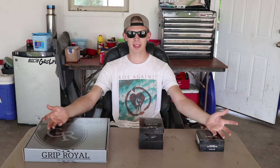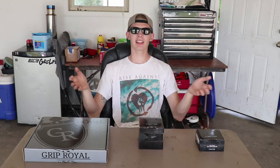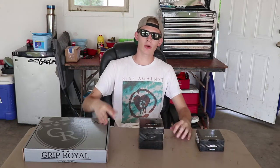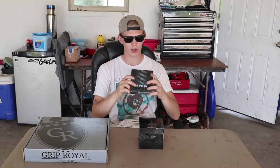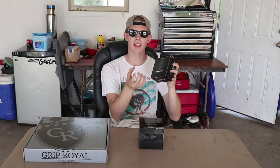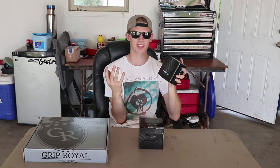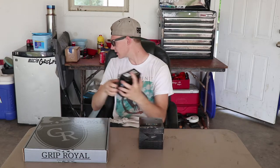What you see in front of me here is the point of the video. Today, what I have before you is everything that you need to put an aftermarket quick release steering wheel on your MX-5 Miata or any car in general. What I have right here is your hub adapter, so that when you pull the steering wheel off, this is what slides over that big center nut, and you bolt that to it and it converts it to a 6-lug. I got the short hub adapter because I'm 6'4 and the Miata's really small, but I'm gonna go ahead and open this and see what this looks like.